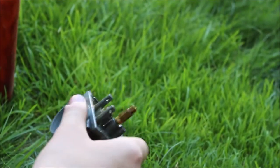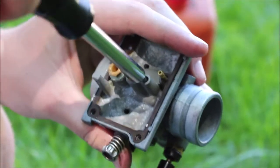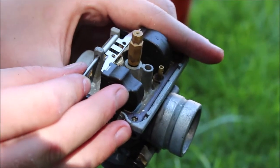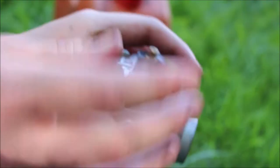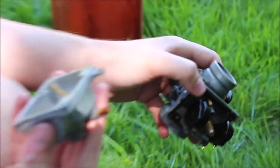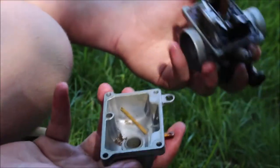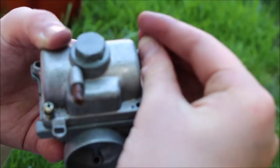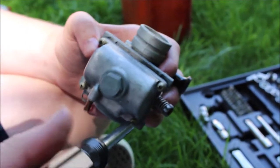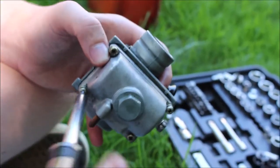This is pretty good. Spray it through this jet, hold it up to the tip. Put the jets back in. Clean it up — we can get this thing idling good. Any dirt in there can clog a jet. It does look really good. Make sure you criss-cross pattern the screws so pressure's evenly applied. Seal is good. Tighten once and then snug so you get an even fitment across the board. It was clean, but there was some dirt in there.